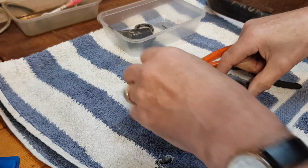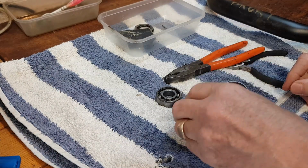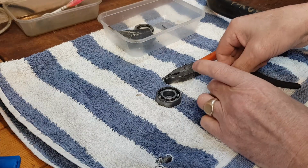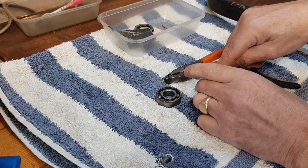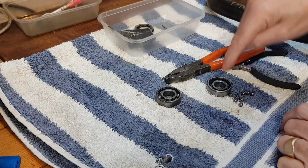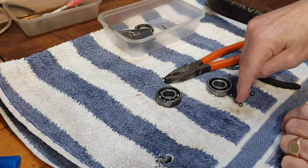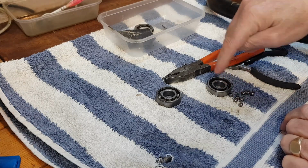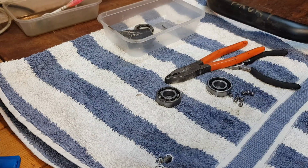And then when you've finished, it won't work now because I haven't got any grease, but you put the bearings back in, you pop the inner race back in, and then with all the bearings spaced out, you can turn the wheel over and then hit on the inner race of this one. And amazingly, even though the cage isn't there, there's enough purchase to knock it out. So that was another lesson learnt while doing this project.